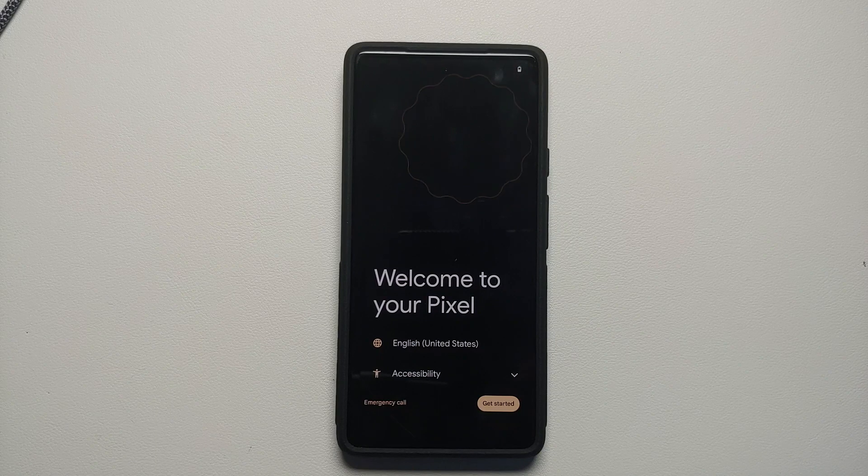Other than that, you will need access to a computer with an active internet connection. Unfortunately, this cannot be done without access to a computer or another phone that lets you push fastboot commands to your device. Drivers also need to be installed if you are using a Windows computer — all relevant links and videos can be found in the description. Also importantly, if you have a Verizon Pixel 6a, Verizon devices do not allow bootloader unlocking.